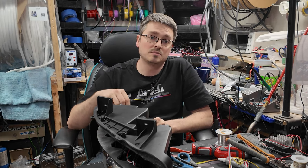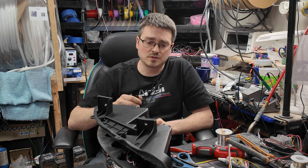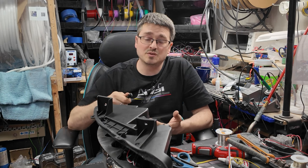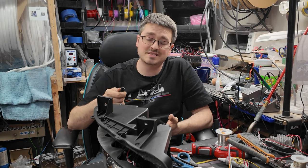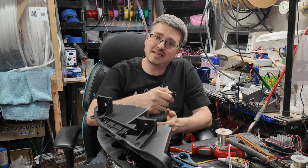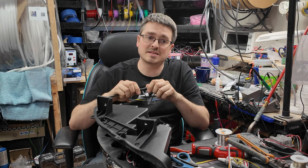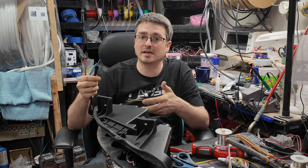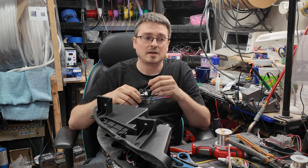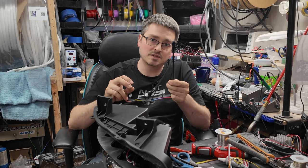The problem comes with a little bit of manhandling by customers. So sometimes if they're plugging in a light or unplugging a light, you know, there's only so many things they can grab a hold of. So most of the time when they're pulling them apart, they're attempting to push the pin in to release the plug and then yanking on the wiring. And sometimes what that does is it actually creates a weak connection at the back of that plug and will actually break the connection. So after having a few people have that issue, I decided to upgrade to this style.